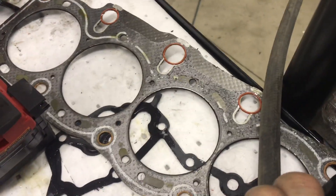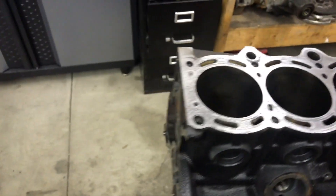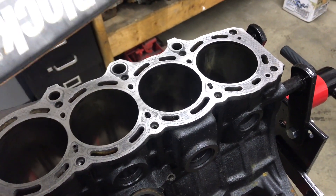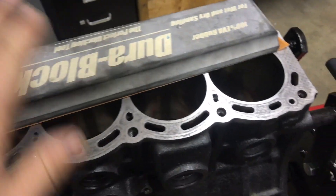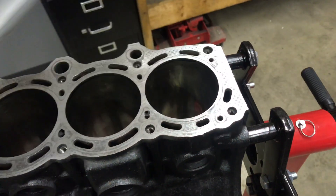The first thing I do is always clean the deck. I use a scraper — if it's got one of these graphite gaskets it's going to leave a bunch of crap on the deck. So I always use a scraper to clean it off. I remove the dowel pins so they don't interfere with the cleaning process. Once this has been cleaned with a scraper, I'll just take a flat sanding board with 80-grit sandpaper on it. All this is going to do is clean the surface — I'm not trying to adjust anything with the deck as far as warpage. This is strictly just for cleaning.